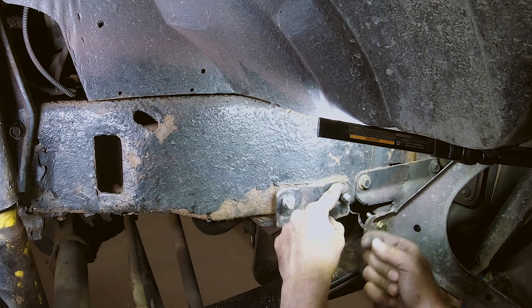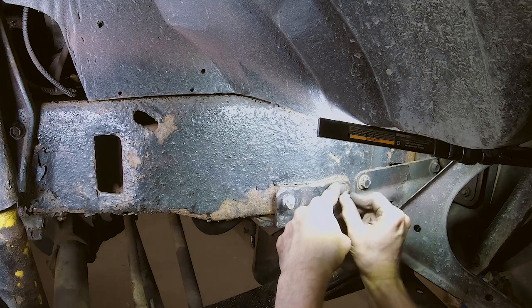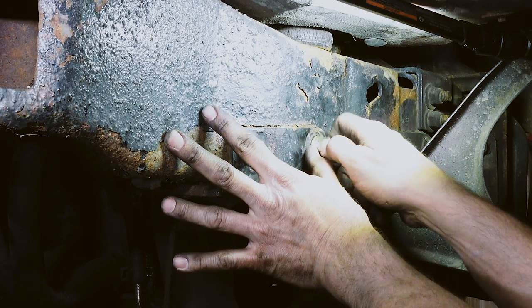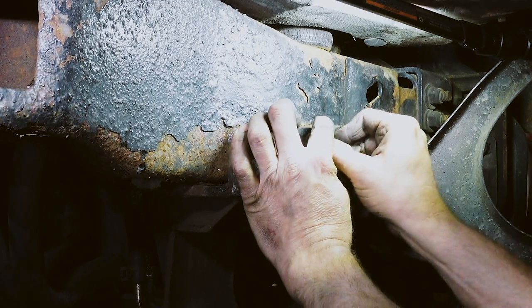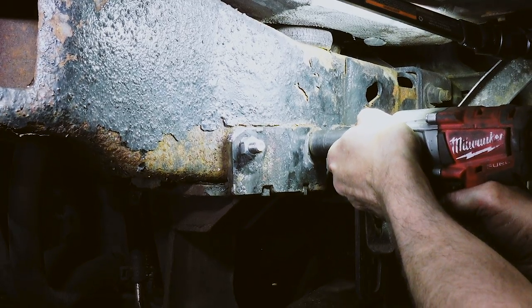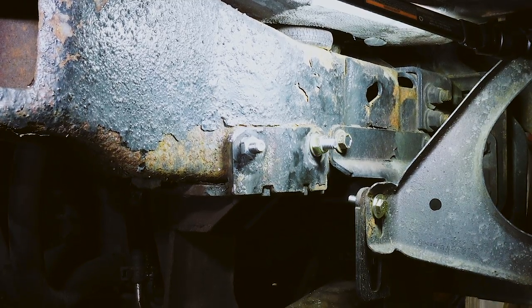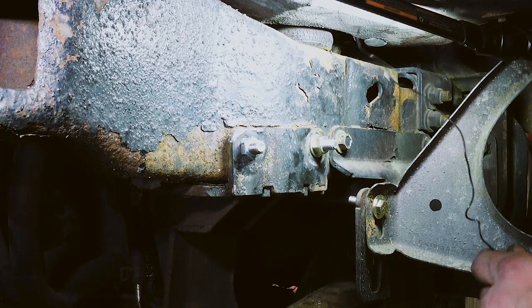The bolt's through now. Undo your wire. On this side you're going to put a washer, hold it with your thumb or finger, and hold the bolt that way. Get it lined up, take an impact gun in the clockwise direction, and tighten it down. Just got the bolt through the frame — simple, quick, easy trick with some mechanics wire.